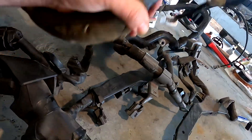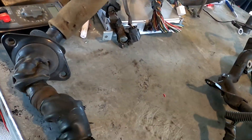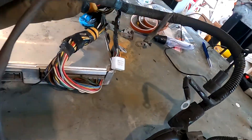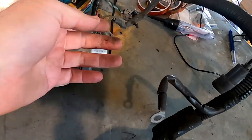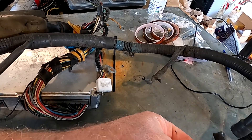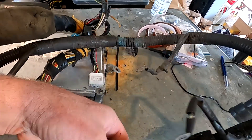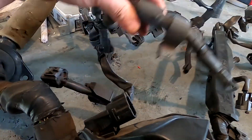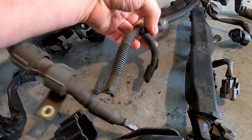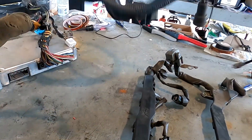This one's got the start loom that goes into the starter motor. There's the battery connection that comes down - this would normally be bolted up under the chassis rail, that's an earth. This is normally bolted to the block - or that front engine mount area. Then this comes around the back of the engine and we plug into the engine harness here. That's your main feed into your starter motor, there's your two knock sensors and your start trigger.